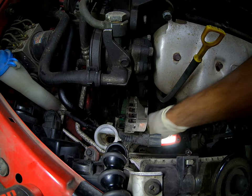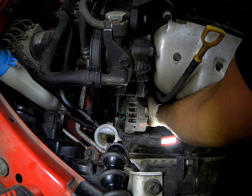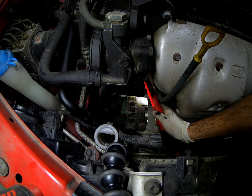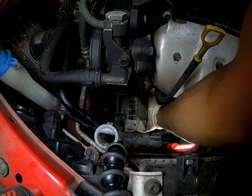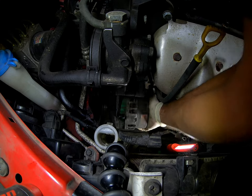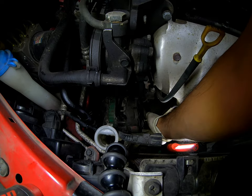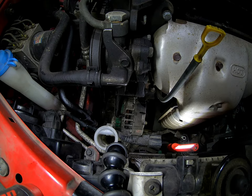You can simply wiggle the alternator loose. There is an alternator belt, and once you loosen the tension on the alternator and push it backwards, you can wiggle the belt off. Don't ask about the belt — that's a different story, at least pertaining to this vehicle.